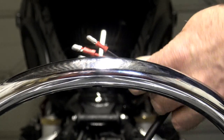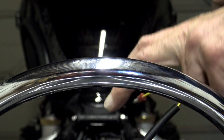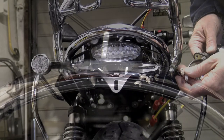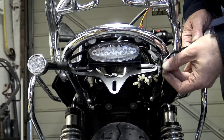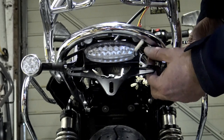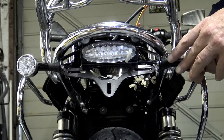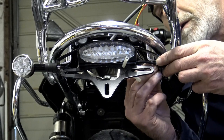Once you've got your wiring harness free, follow their instructions on how to wire their lighting unit up to the harness using the bullet connectors. At this point also remove your stock indicators from your factory fender and transfer them to the new brackets fitted to your bike. A little bit of advice: if you're like me and sometimes get confused as to which wire goes where, take a photograph with your mobile phone before you dismantle your original factory fender so you've got a record of the wire colours and what they relate to.